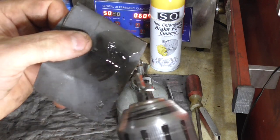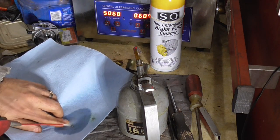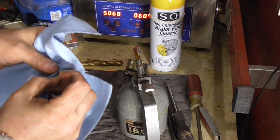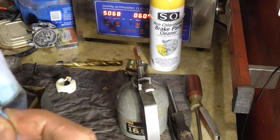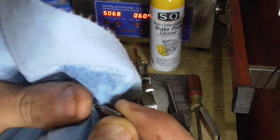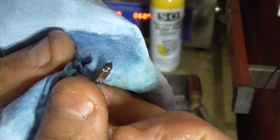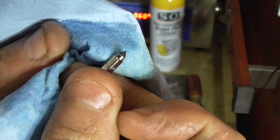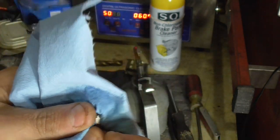And that's all it takes. I'm going to clean this up and show it to you. The other reason they sometimes leak is you get debris on the needle — in this case you can see it's rusted — but that tip looks perfect, absolutely perfect. If you have that ridge going around there because it sat in the closed position like that, a lot of times it will leak gas out of your carburetor.